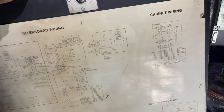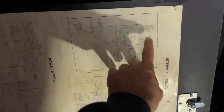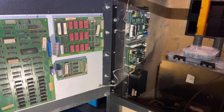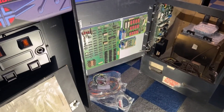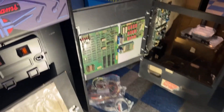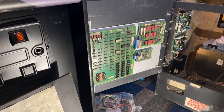This is the original paper that was on the back of the game - at least nobody took it off. We have our main board here, CPU board, ROM board, and interface board. I'm going to rotate this around so these three boards are in the right configuration as they are on the door, so we can just look up and get these plugs in the right positions, then work our way into the soundboard, power supply, and power brick.